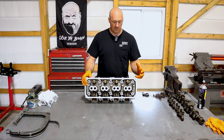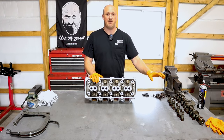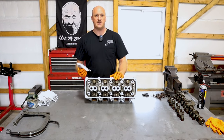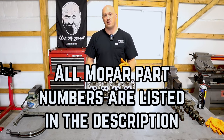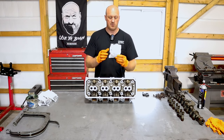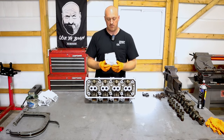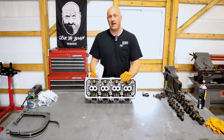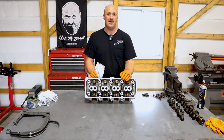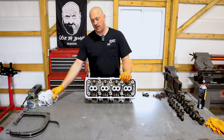One, because I wanted to clean the thing up real nice. But more importantly, because I am installing a camshaft, I'm actually going to be replacing these valve springs with some uprated valve springs. We are keeping this on a budget theme, so I'm doing these Mopar performance valve springs, which are very reasonably priced. These are not extreme valve springs — if you're going with a more top-end cam, you'll probably want the aftermarket set. However, for the 6.4 cam I'm installing, these are going to be a nice simple upgrade.